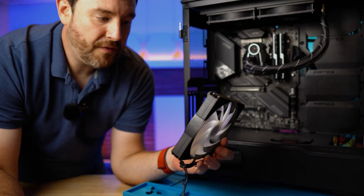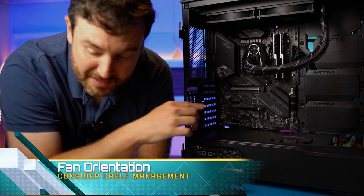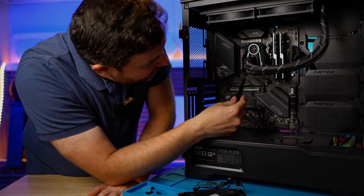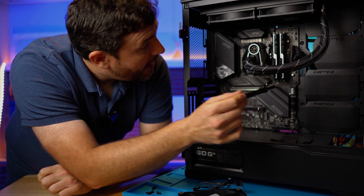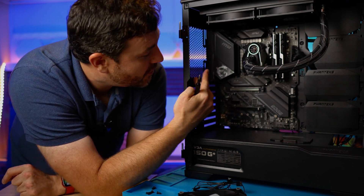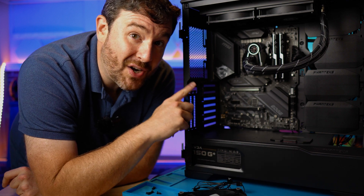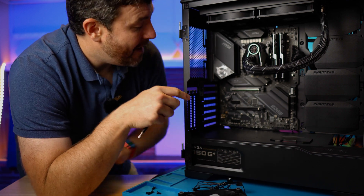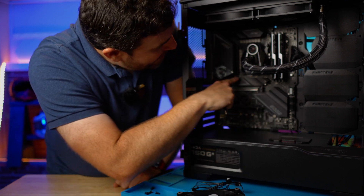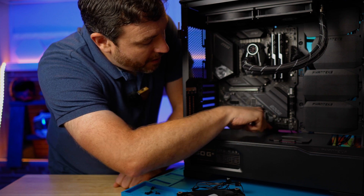As you're getting ready to install the fan, you might be tempted to simply install it so that the logo is facing up, but you have to take note of the placement of the fan headers themselves. I have a fan header right here that I can take advantage of, along this edge and this edge. In this particular case, because this is going to be my exhaust fan, this header here makes the most sense to tap into. This is a very common place to find a header, because having an exhaust fan directly behind the CPU fan is a good way of increasing your thermal output. I can also string this all the way along to the front here, taking advantage of these gaps in the case.